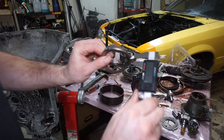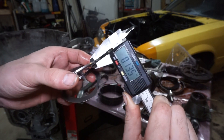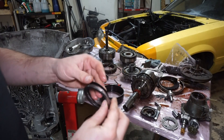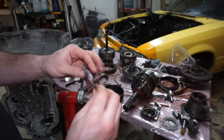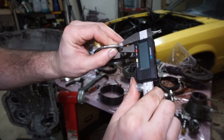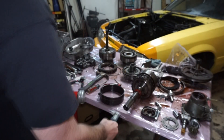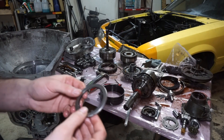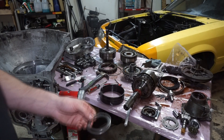If we measure this bearing, this comes out to like 135. I'm gonna add this shim to the backside of it - the kit comes with three different thicknesses of shim. I add that, and this is the closest size. I already measured this - 148. So it's pretty close, that's the one I'm gonna go with. This is how I'm gonna put this thing in the case: I'm gonna put the shim down first and take the black side and put that down.